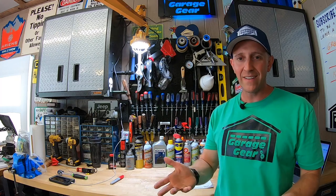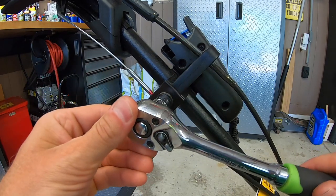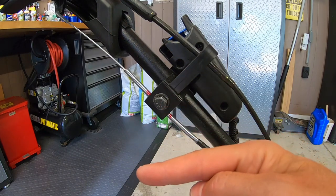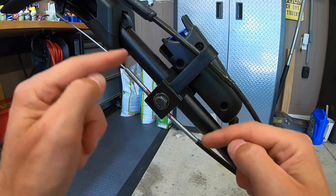The mower should still move — not ideally, but at least we could come back to this if we need to. From here, take a 7/16 inch socket, stick it on that bolt, and loosen it up a few turns. You do not need to take this bolt all the way out. Then ever so gently slide this metal rung section of the cable up or down. To increase your traction, pull the cable down toward the engine. To decrease your traction, pull the cable up toward you.